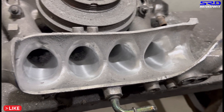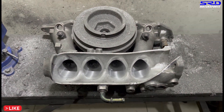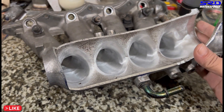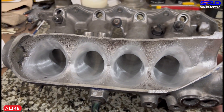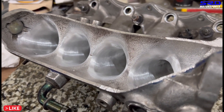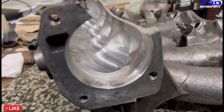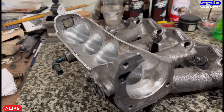Would you look at that? Those are velocity stacks. After a few more passes we're going to wash it up with soap and go back to the workbench. Here it is now — it's all finished up. Now it's got to be ready to be welded and it's going to be more efficient. You can see it through and through. Runner number four — or number one — it looks like a velocity stack. We know this is going to pack really, really good airspeed. It's going to be more efficient, fill the cylinders with good combustion, and it's going to be more power.